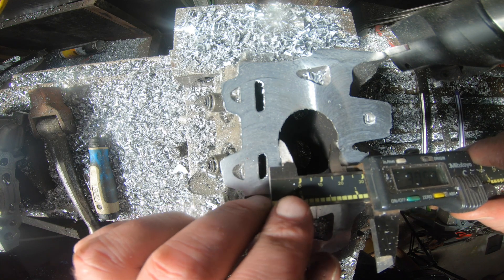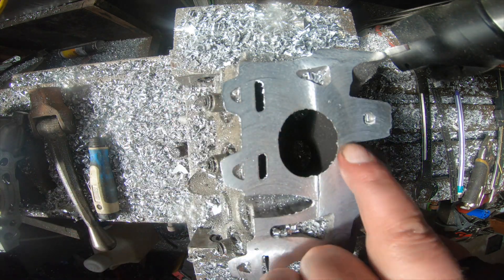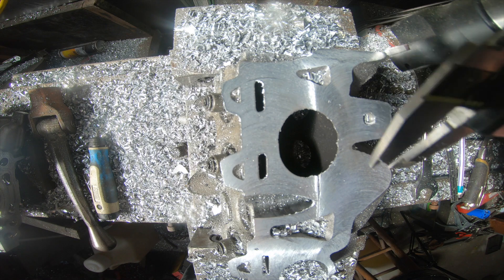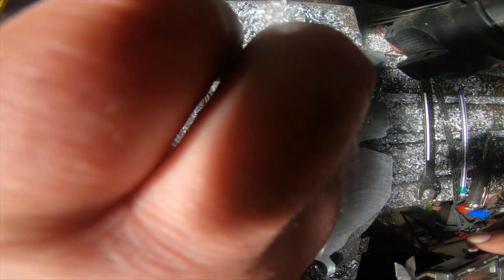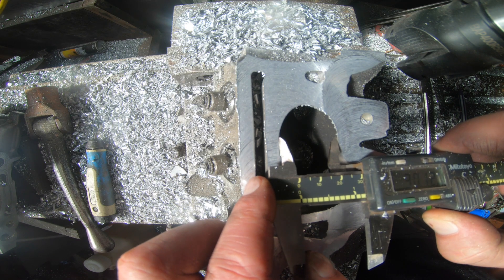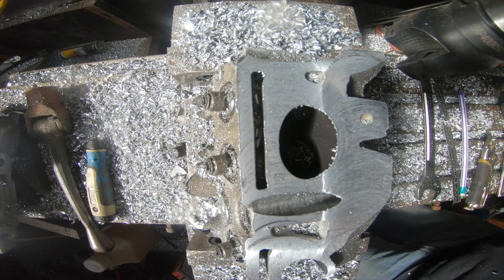36.8, 32.5 — and note we're 30 millimeters down here. Keep in mind the port was angled, and this is the first time we're really starting to see something come close, and even that is 7.5 millimeters. So definitely lots of room to expand this port. At 35 millimeters down it's looking like the top of this port — you're not going to want to take anything off the top. 30.1 by 40.2 — let's see what it looks like when we keep going, but I don't think there's going to be much room up there.